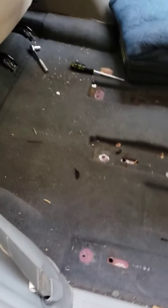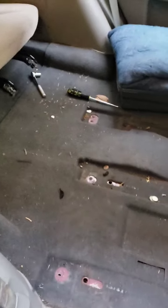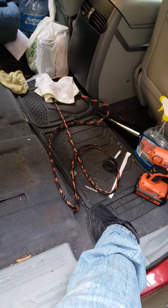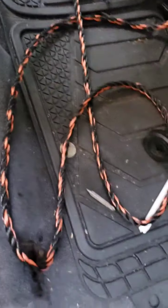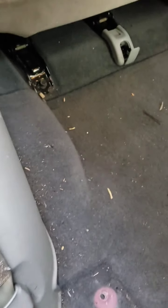But we'll see, because I may end up having to put in a couple pieces of wood for shims, so that the floor isn't dipping down in the front. But I highly doubt that it'll do that, because I'm using 1/2-inch plywood. But if it does, then I'll just throw in some 2x4s in a couple spaces. There's about 2 inches, I measured the space, about 2 inches on each little dip, which sucks because, I mean, look at how much space they're taking out. But I guess they had to for the wheel well.